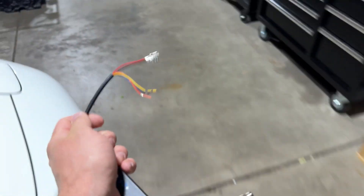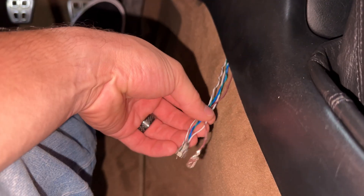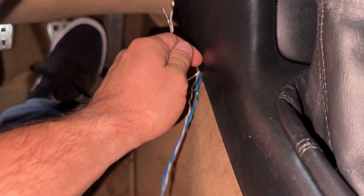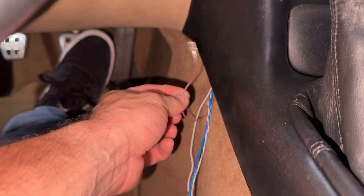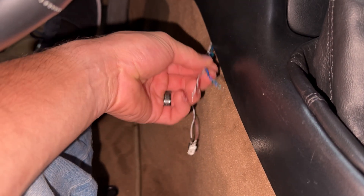First things first, we're going to get the ProLink Plus and hook it up to the wiring that we already installed for the AEM gauge. Here's the gauge I installed last video and here's the wires I was talking about. You have a whole mess of wires right here but we're really only going to focus on two: the white one which is your analog out, and the brown one which is the analog ground. You can pretty much ignore all the other wires.